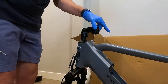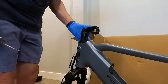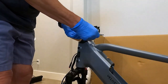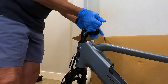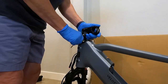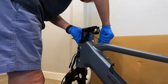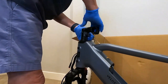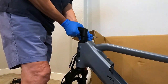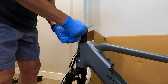From the factory, the handlebars come with the headset pointed backwards, so we're going to have to loosen these screws, take the bracket off, and turn them forward. We'll use the M5 hex wrench, put the bracket back on, start your screws, bring it around to the front, get it close — you can square it up later once we get the tire on — and then just tighten those up a little bit.